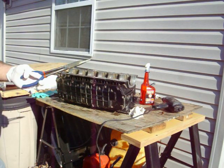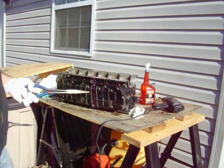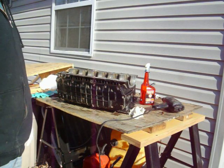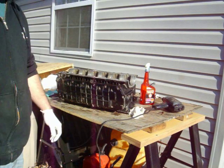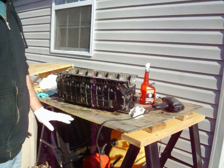Slowly but surely I checked to see if there was any bubbles from any aluminum. I didn't have any big bubbling issues. I don't know if it was just maybe the muriatic acid now isn't as strong as it used to be, because everything's going green and it's safer or whatever. After that, I washed out the cylinders real good to make sure there was no contamination of acid.